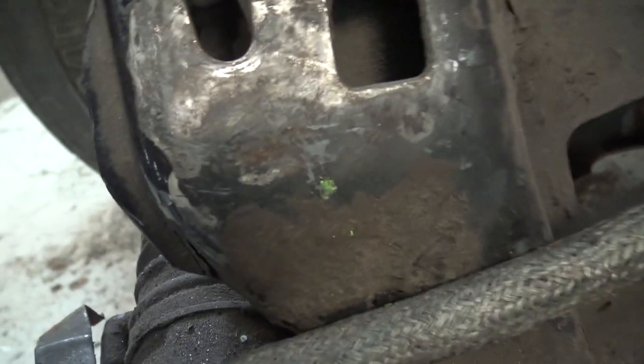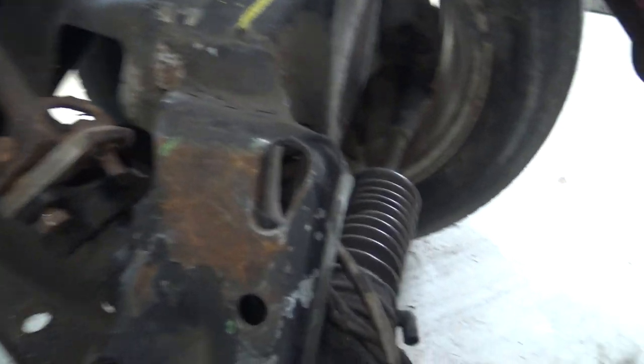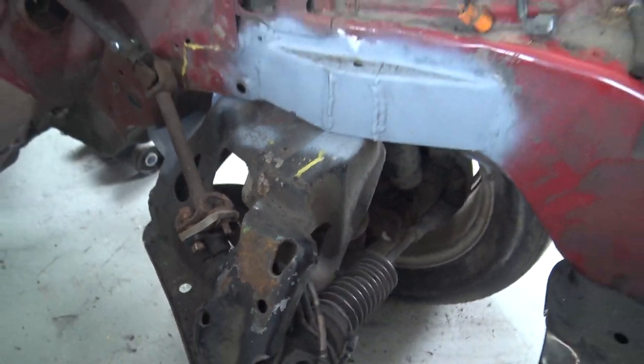Not the greatest marks, but I can see one, two, three. On this side I think I only got two, but that's okay — here's one and here's two. The third one was kind of off in the middle of nowhere, so that's what the plates are for. I'm realizing the three holes I planned on using might not actually be the best. The subframe has a limited area I can use, so it might not be far left, far right, and middle bottom — I might be using two offset holes. Once I get these plates in, I'll be able to tell better.